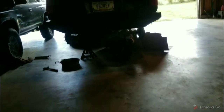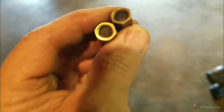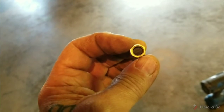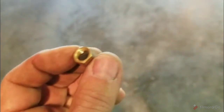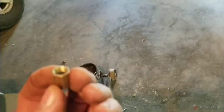I'm getting ready to pull the axles out and I think I'm just going to fix the rear end that's in there. I'm going to have to undo my brake lines at the wheels because you have to take the axles out and the wheel cylinders come with them. I made these two little things to stop my brake fluid from draining out — they're parts of a compression fitting with a little piece of rubber in the end. You can also take a brake line, mash it flat, solder it, and crank it down. They make things you can buy to plug them, but I'm cheap and make it myself.